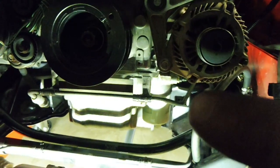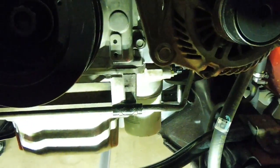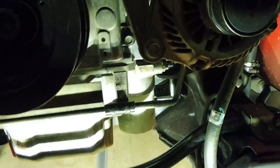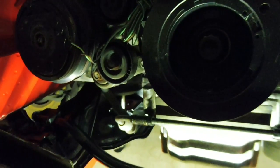And you can just have a look. I don't know if you can see it, but those bolts there, that's the bottom of the engine mount, both sides. You can see the other one. And the light's difficult for the camera, but you can also see just to the left of that bolt there's a hole in the K-frame, so we've just got to shimmy it back until we can drop those into those holes, both sides. Lower it down and the engine's sitting.